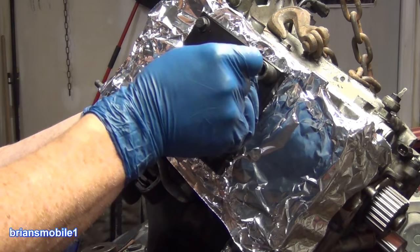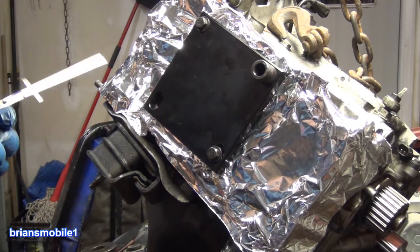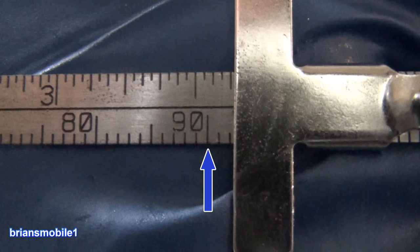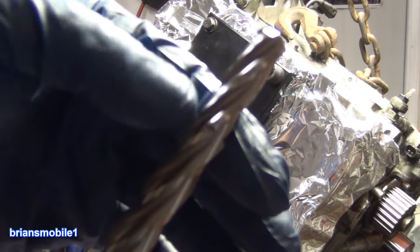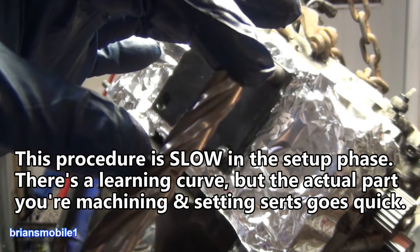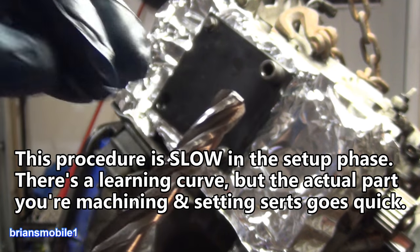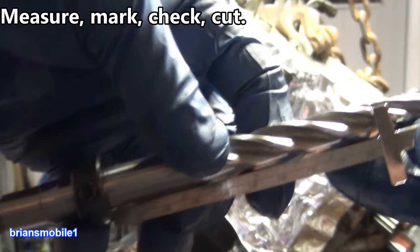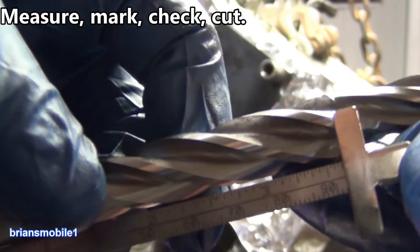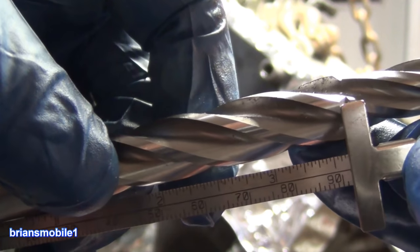While I'm hitting there, I'm gonna grab the end of my ruler, slide that down, and then just settle it out and take a look. This is our measurement right here, 90, 91, 92 millimeters. That's including the dowel. With our core drill, with our little shoulder cut out, that's what we need to know: how deep to go to get this to land right at the first thread. Because we take our ruler and put that against where it's going to go, and we should land right on that shoulder, right at the top of the shoulder. Just first dropping off from being a large diameter to a smaller diameter.